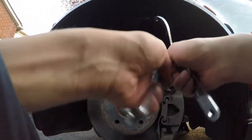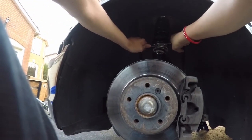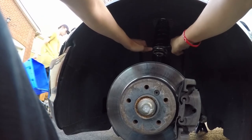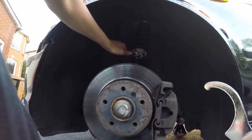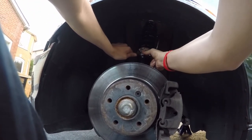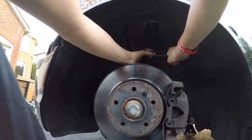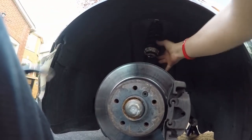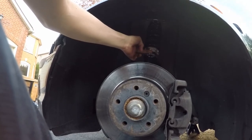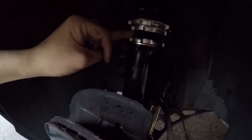The way you tighten these two, right here. We're pretty sure this is maxed out, it's not letting us go down anymore. But you tighten, you push opposite ways with each spanner wrench like that. And that tightens these two together. Then you make sure that this bottom lock ring is locked in nice and tight. You don't want to over tighten it cause that makes it a pain if you want to adjust it later. Just nice and snug like that. And there you go. We've got like a fingertip gap right in there. We're going to have some nice fitment on this bad boy after.